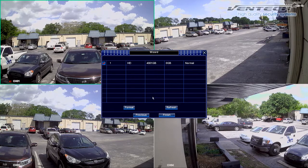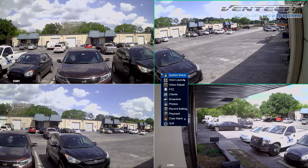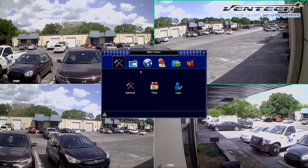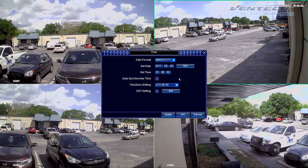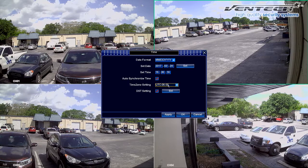In fact, the DVR will start recording automatically. However, playback and record settings will be explained later. By doing a right-click on the main screen, we can access the main menu. Please select System Setup. The first submenu is General — this first option allows you to modify the time and date. Please select the Auto Synchronize box to get time from your local network so it will always be synchronized. Here at Time Zone, we have selected minus 5 which corresponds to our local time, and please check this box at the bottom to allow any time zone changes during the year. Please click Apply and then OK.